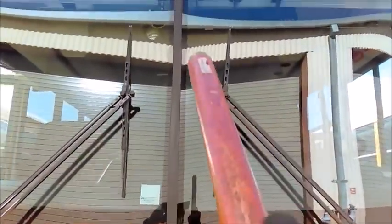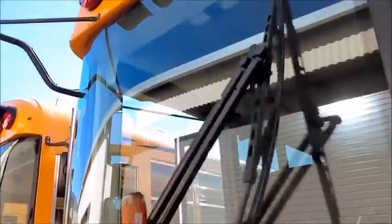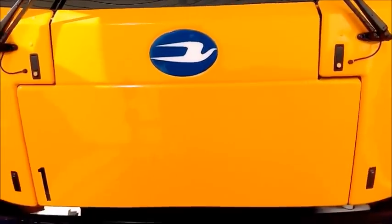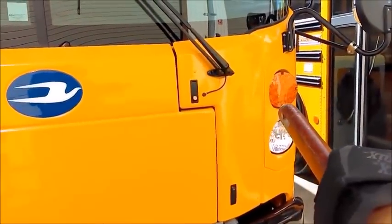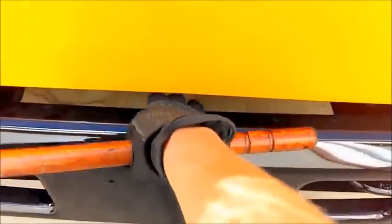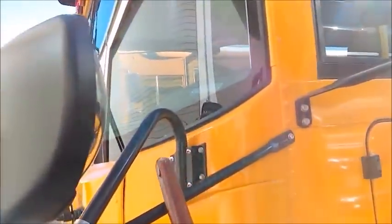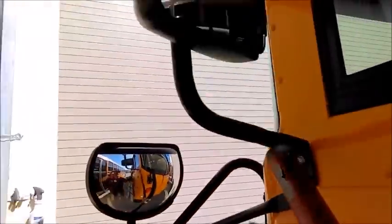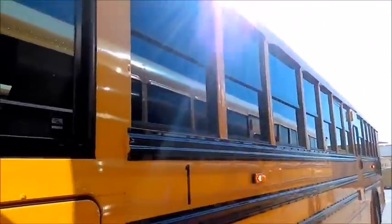Check your wipers—make sure they're not loose or cracked. Front body of the bus: no damage. Check the bus number. Both headlights are operating. Left turn signal on the bumper—bumper is secure in place. Check mirror brackets—secure to the body of the bus. Three mirrors: all clean, free of any damage or cracks. I check as much as I can see to the back—clearance lights and marker lights are operating. Side blinkers on the right side are working simultaneously with the left turn signal.